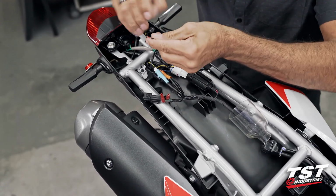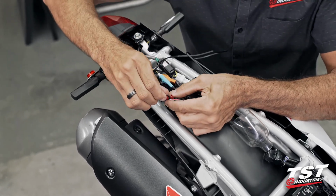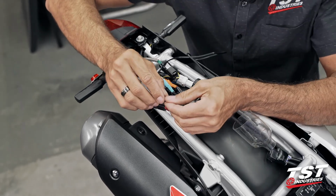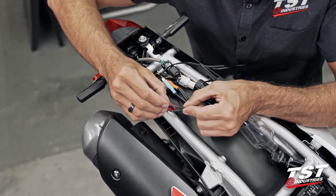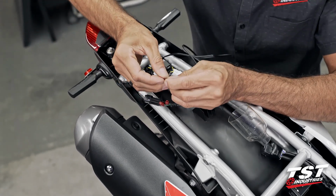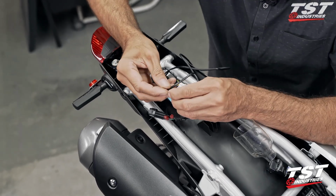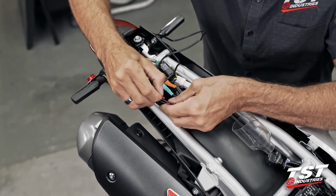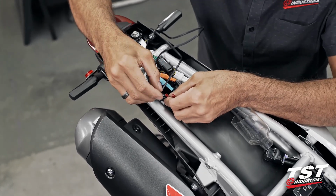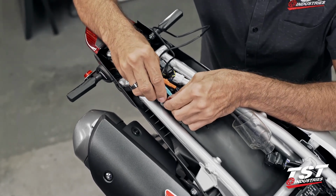Let's grab the end of the wire here and remove the smaller cap from the opposite end of the connector. And the non-threaded end will go over our wire. Just need to make sure that you have enough protruding, a tiny little bit showing out of the rim here. That looks to be good. I'm going to screw this in now. Again, black to green, and then red to black.